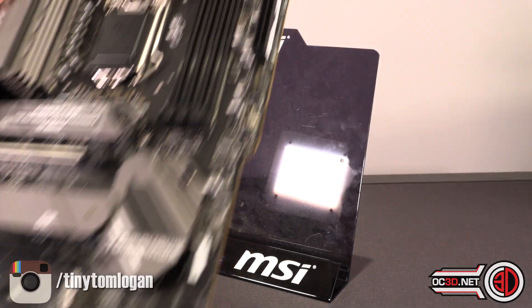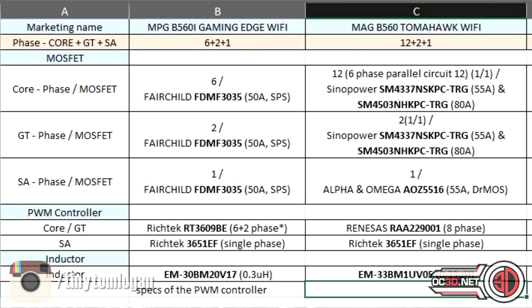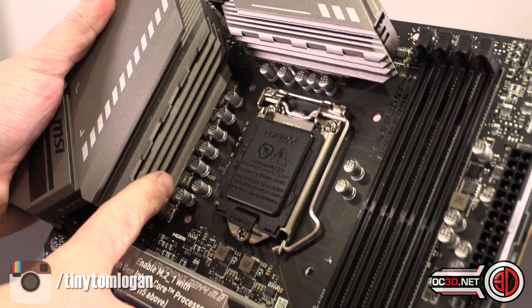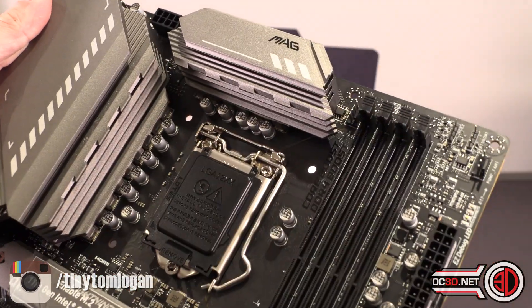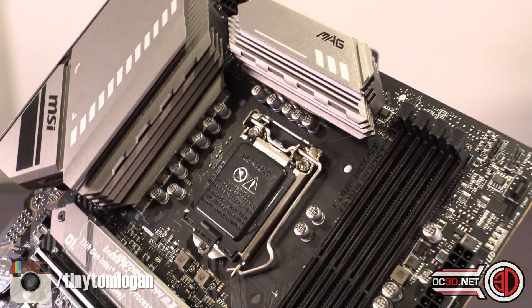I've been trying to find information about the VRMs, which is where I'd normally like to start, but other than saying it's digital and there are eight phases, that's pretty much all I've managed to get out of MSI. Their reviewer guides are incredibly lacking on that side of things. This rear I/O shield is huge and it's all extruded aluminium. Most of the power phases down here are for the CPU, a couple up here are also for the CPU, two are for the GT, and one is for the system agent. They're not connected by heat pipe or anything, and I did want to cover more information, but it's just not readily available.